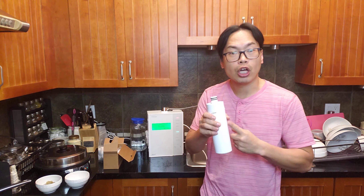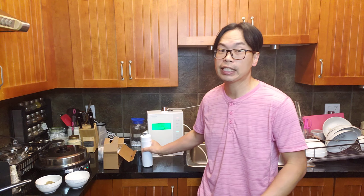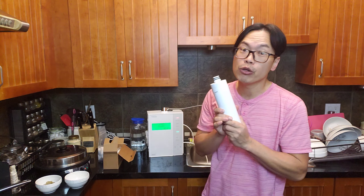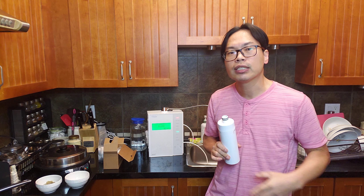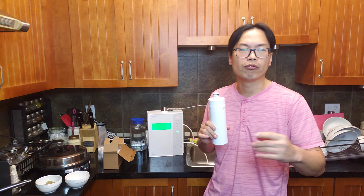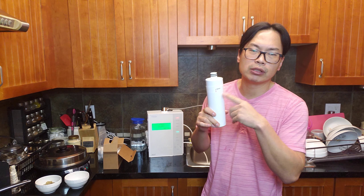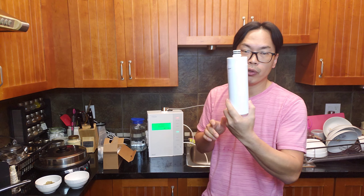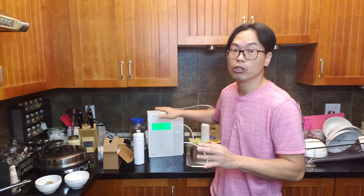The filter stops dirt — and when it does, it gets clogged. Unlike a shirt, you can't wash a water filter; you have to replace it. If your water is especially dirty — often very fine particles around five microns — the filter will clog faster and water flow will slow down. That's a filter issue, not a machine issue. Don't blame the machine.